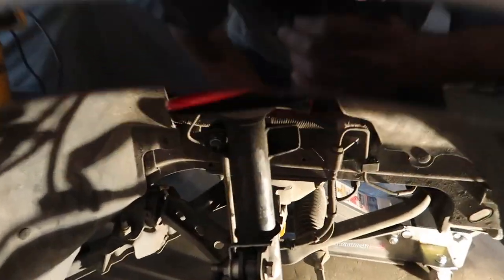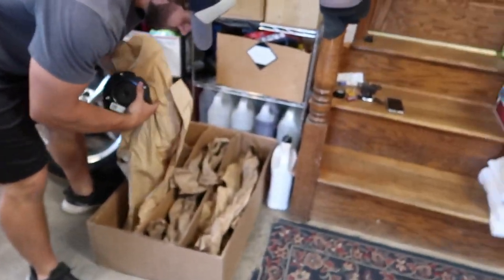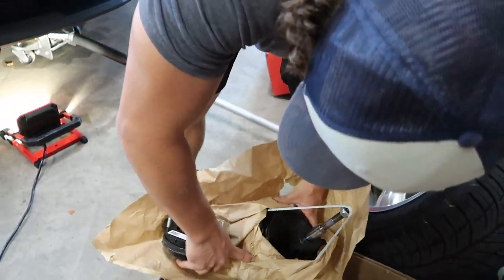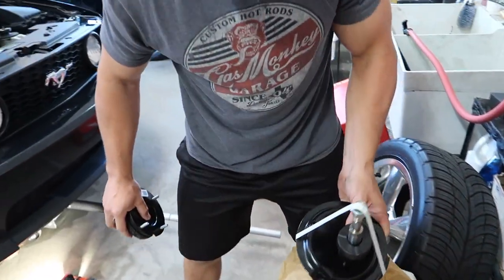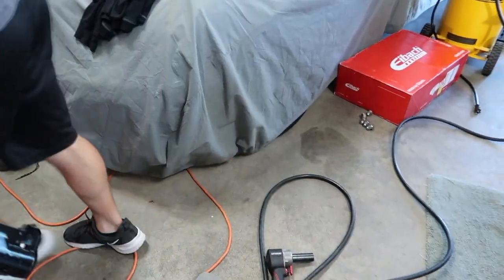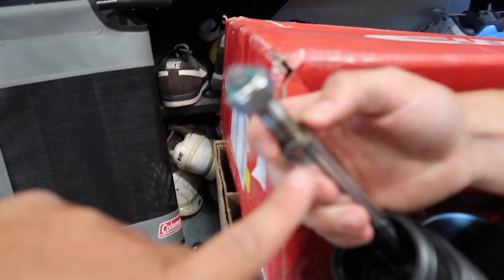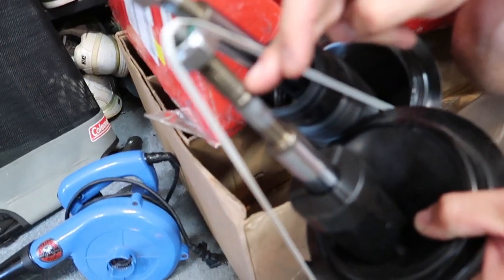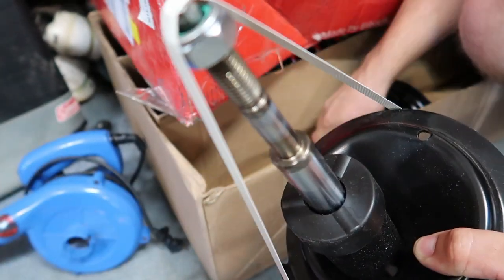Let me show them what we had before. We got the 2011 and up lowering springs installed — obviously they are not right. Here are the new ones. There's a problem with the design of why the other ones didn't work. On the wrong one, it has the threads then this thick part. On this one — the correct one — it has the threads then a thinner part. That's where the strut mount fits. Completely different design — machined a little bit farther so the mount can go through. These are the correct ones so we're going to throw them back on.